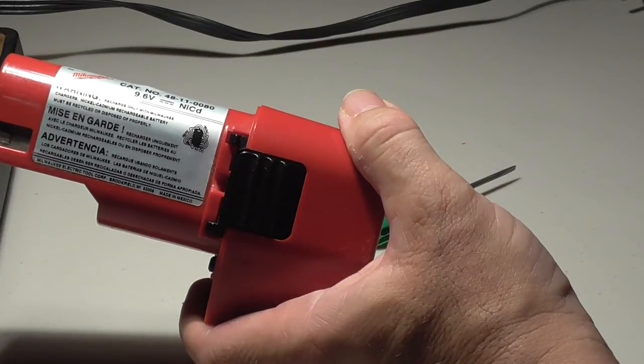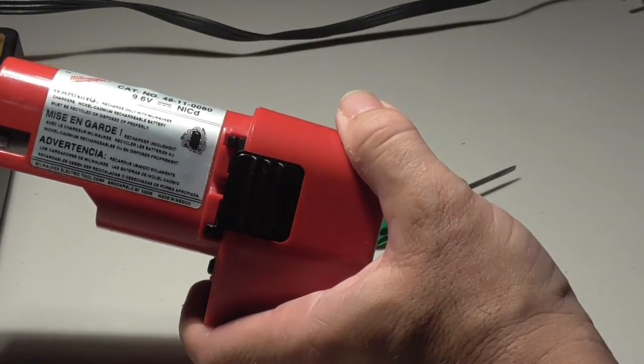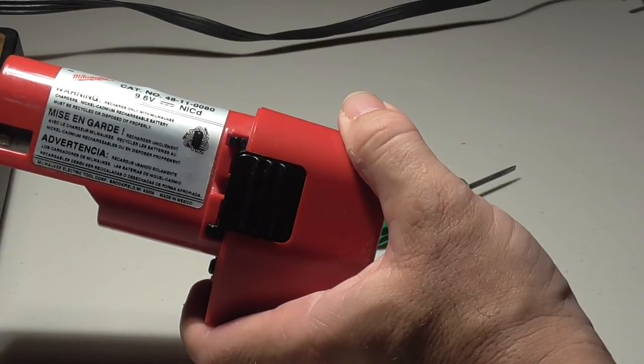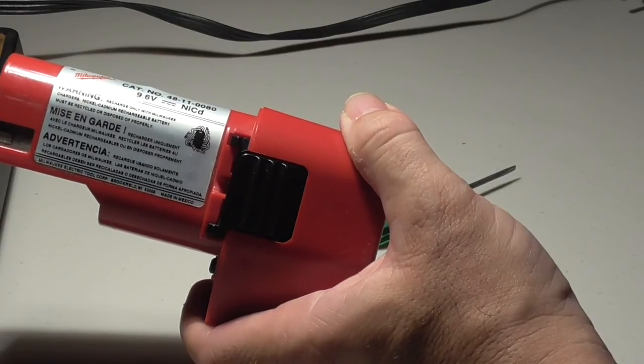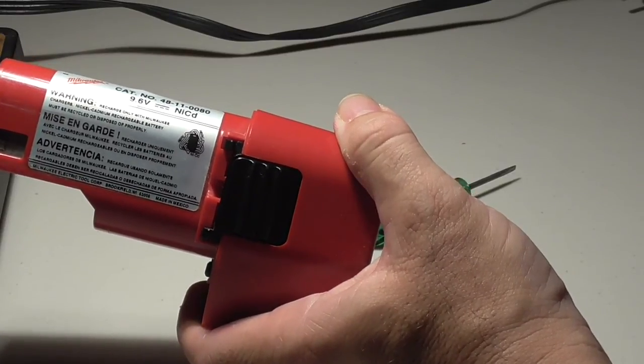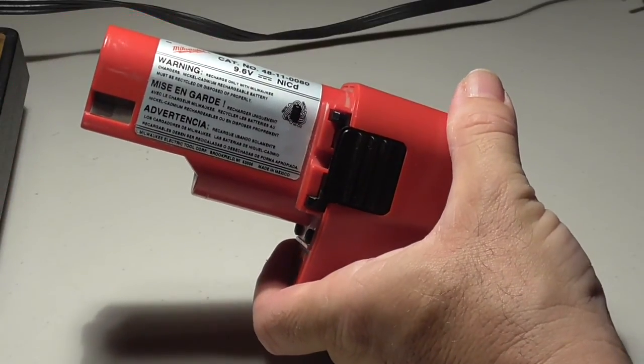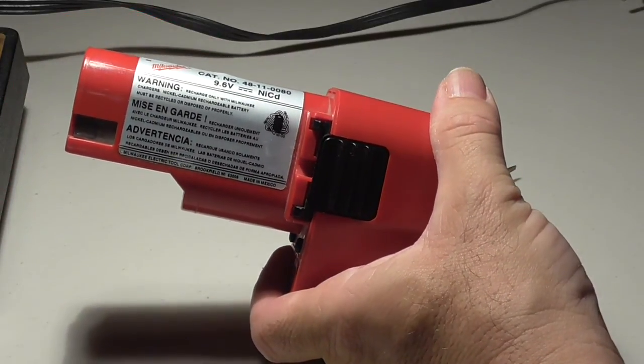I would take some sandpaper or a metal file, and try to scrape off a little bit of the metal, just a little bit to get it roughed up so it will handle solder. You will definitely need flux if you solder something like that. And you can probably use the same wire pack, the same wiring harness that it came with.